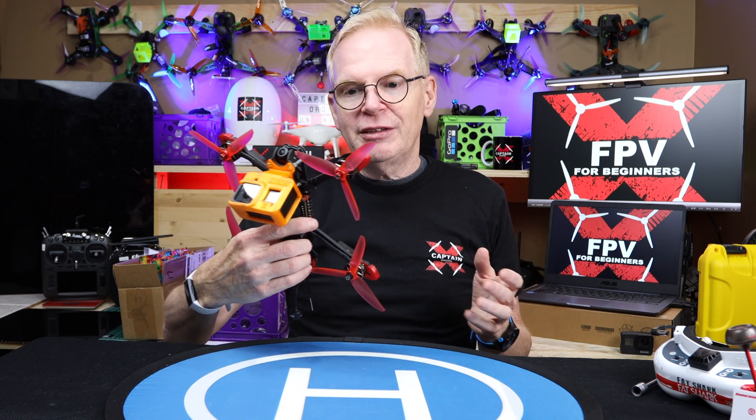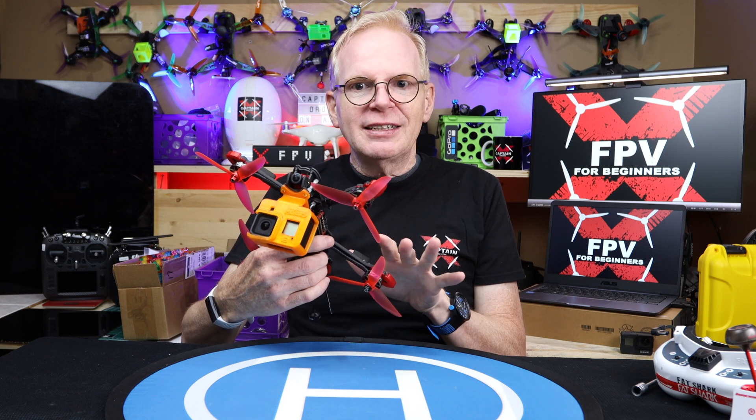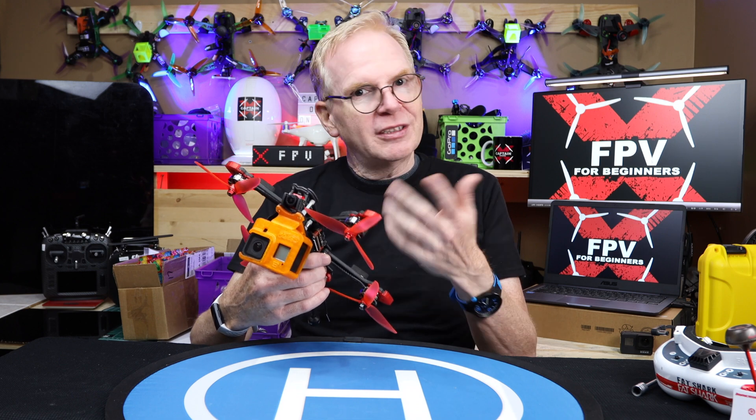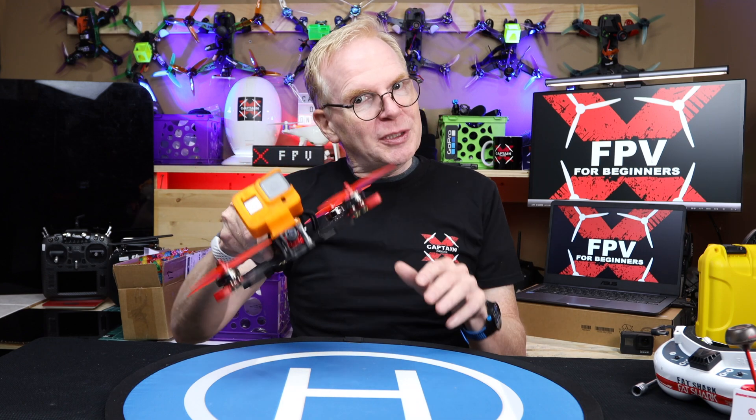In this episode, we're going to take a look at props for your drone. You can buy any type of prop out there — two blade, three blade, four blade if you want, different sizes, different shapes, different angles, all of which benefit your drone. I'm also going to show you how to put your props on, because there's only two ways. They're not idiot-proof like on DJI drones — you can actually put the props on the wrong motors and have your drone flip all over the ground and take somebody's eye out. So we don't want that to happen.